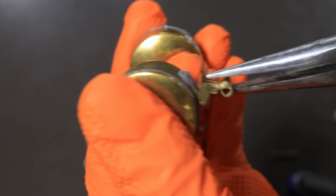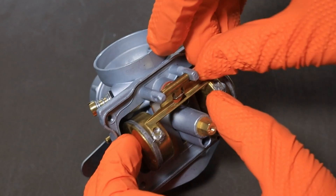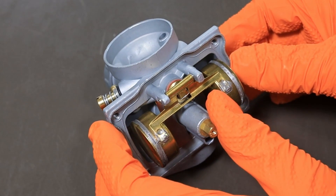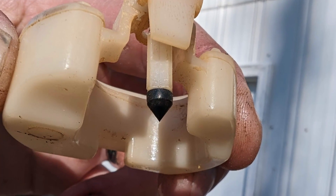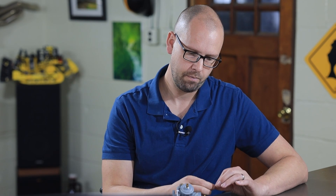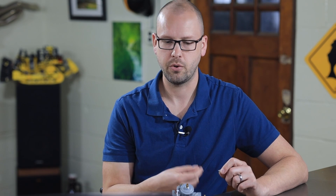Just keep in mind: if you bend that tab up, you're actually going to be lowering the fuel level in the float bowl. So don't get too aggressive, or your engine could be starved for fuel under full throttle. If you've got a plastic float, I wouldn't do this. You can use a soldering iron to bend the float part down relative to the tab, but I'd only do that on a junker. If it's a nice carb, I'd focus on the needle and seat and just buy a new one if cleaning didn't fix it.